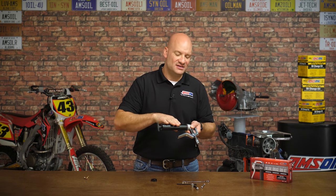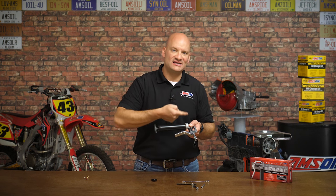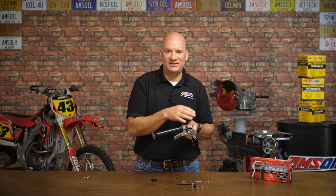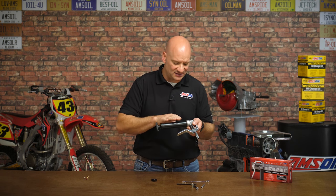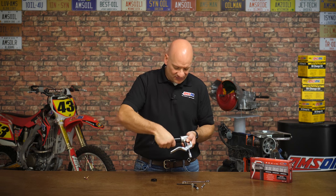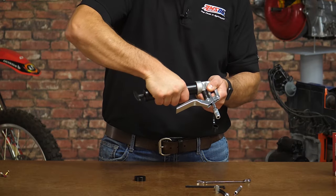The spring is now putting pressure on the grease into the handle of the gun, and you can tighten the body back down. The reason we do that is when we turn this body to tighten it, those last few threads help to squeeze any air that might be in there out of the gun — because air is a major problem in a grease gun. It has to be pure grease; if there's air in there, it does not want to pump. This is a little trick that helps eliminate air problems. Go ahead and thread that down all the way and tighten up real nice.